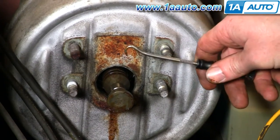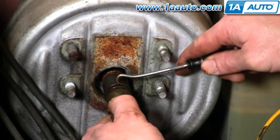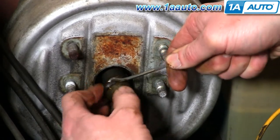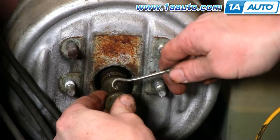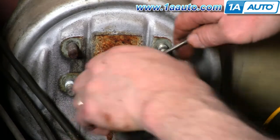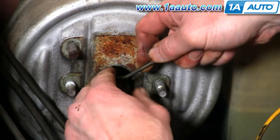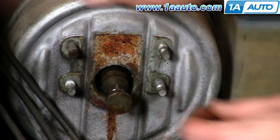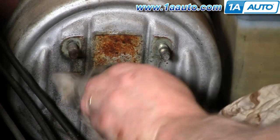To get those seals off, I'm going to use a little hook tool. I'm just going to pull out this plunger, stick it right in there underneath, pull them up and pull them out, and then pry them with my fingers. The right tool makes a lot of difference here. There are the old ones. Let's use a rag to clean this up a little bit.